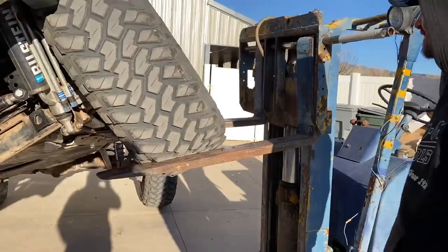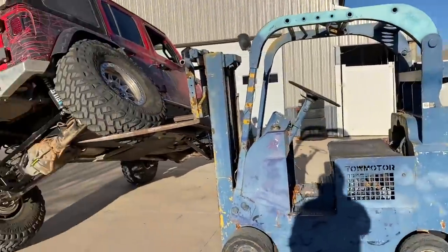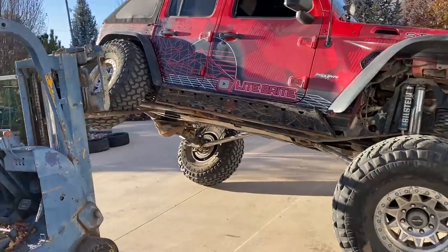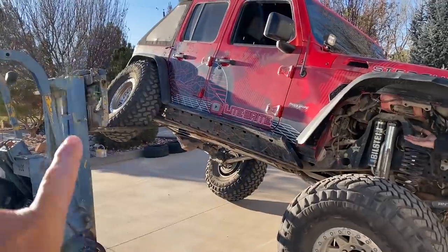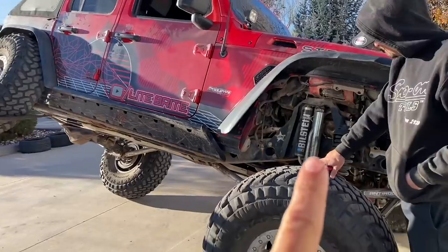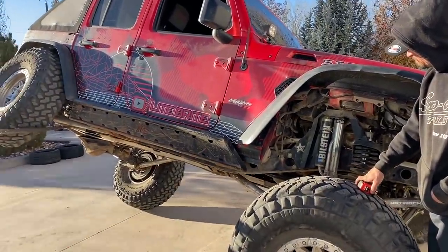She's completely full. But let's go check out the flex wall, because I think we were at 36 before at 30 psi. Let's go see, because God, look at that. Guys, I forgot to tell you, my fronts are 10-inch bypasses, and the rears are 12s. We removed the limiter out of the rear to get 13 and a half. The limiter's removed out of the front to get 11. So it was 11 and 11, now it's 11 and 13 and a half.